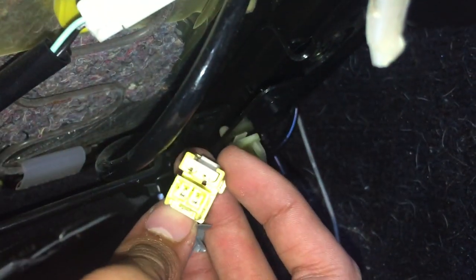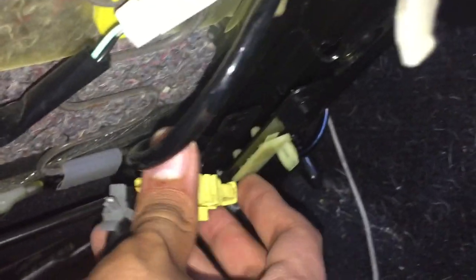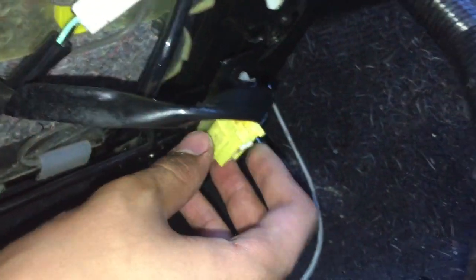I've packed this connector pretty full of dielectric grease and ran it in and out of its socket probably five or six times at this point. What we're going to do is plug it in the last time and connect it back to this bracket, but don't zip-tie it. Zip-tying it was what a lot of people think hurt it in the first place.